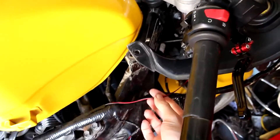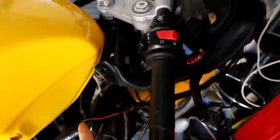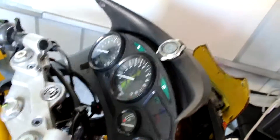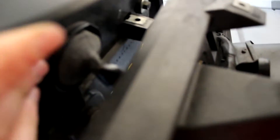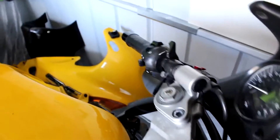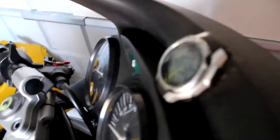Now I've got a bit of an issue because I've got an LED connected for my alarm, but if you don't have that then you can just lift this straight out. And then behind here you've got your main instrument. This rubber boot - I'll just pull this back. That's where the actual connector is, you can just pull that straight out. I can't remember if there's a clip on this one - yes, there's a clip on the top. And then it's disconnected.